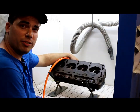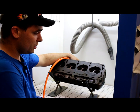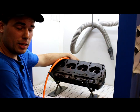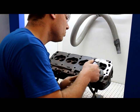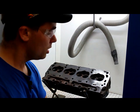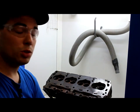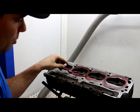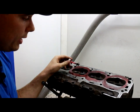The head we have here was actually in very bad shape when we found it — covered in rust and just needed to be cleaned really well. What we ended up doing was acid dipping the head, and that's the reason we have this black finish here. Right now we're cleaning off the deck surface of the head after acid dipping so we can scribe for the chambers. We're putting some dykem on so we can scribe our lines with the head gasket bore later.